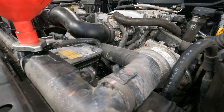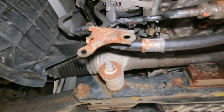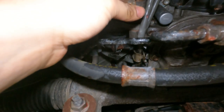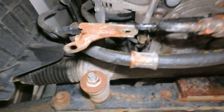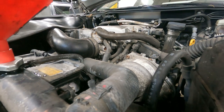How could the freaking battery die if it's not hooked up? I may have made a Goomba move, guys. Car wouldn't start, battery's fine, and what do I find? I didn't put an engine ground on. I bet that's stopping me from starting. Oh, knowing is half the battle. All right, take three.